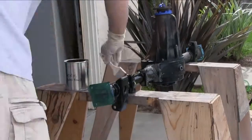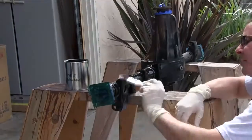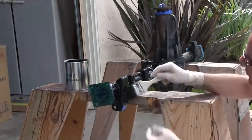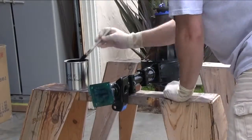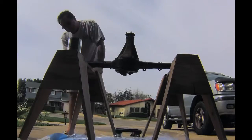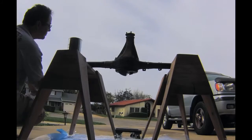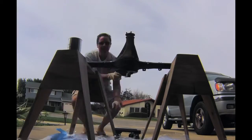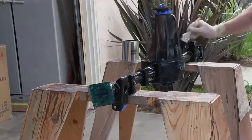Found this out the hard way while painting my battery tray. When I painted the backing plates for the rear brakes, I did the second coat the next day — you're not supposed to do that. The second coat is supposed to go on while the paint is just a little bit tacky. Also use thin coats. Get it too thick and it won't flow out — it's blotchy.